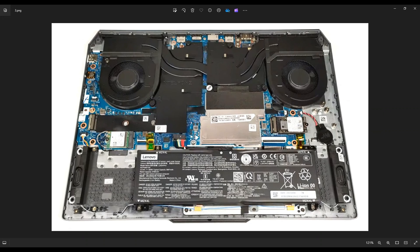The battery plugs into the motherboard right here. As you can see in your computer, there's a small grip on either side of that black plug. You can use your fingernails or a pry tool and go one side at a time and pry that out from that plug. As with any computer plugs, you want to avoid pulling on the wires as much as possible — just manipulate that plug whenever possible. Now that the battery has been either removed or at least unplugged, it's safe to proceed deeper into the computer.